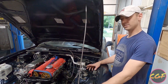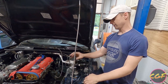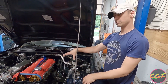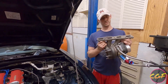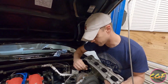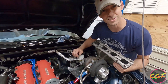The easiest way to get the oil drain in there is to attach it to the turbo and position the compressor housing directly into the intercooler pipe. It's really tight — a really short oil drain. So be cognizant when you're putting the turbo in, try to line up everything while you're putting it in. We're throwing the turbo in there. Before laying the turbo all the way down, I'm going to get the oil feed on. Getting to the oil feed is extremely difficult, so I'm going to install it first, then set everything down in there.